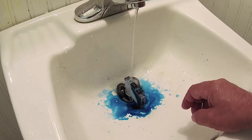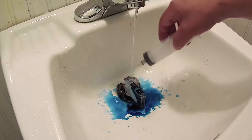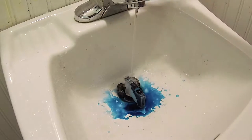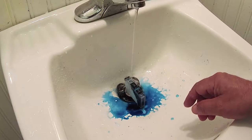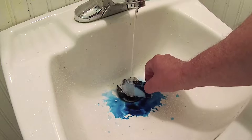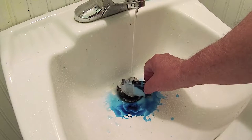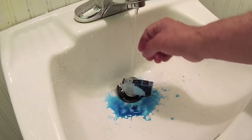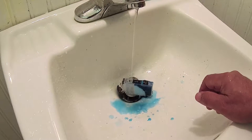You simply continue to do that, just let it sit there and dribble, and within about 10 minutes it'll be nice and clean. You could also load a syringe full of water and run it directly through that newly created fill plug hole. We'll let it dribble and come back when it's done, then I'll show you one way to clear the CLI-42 yellow cartridge.